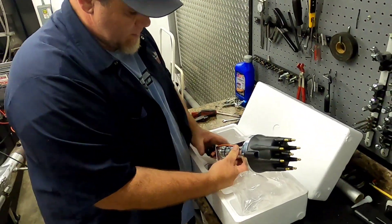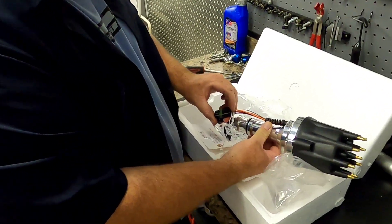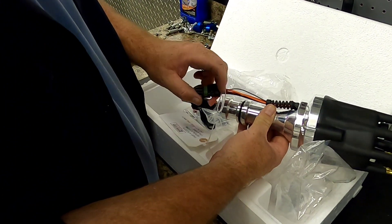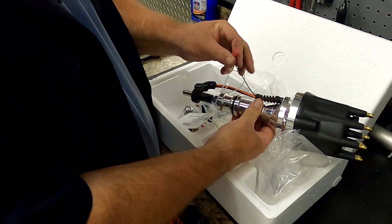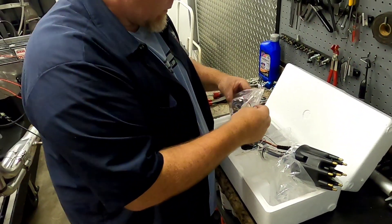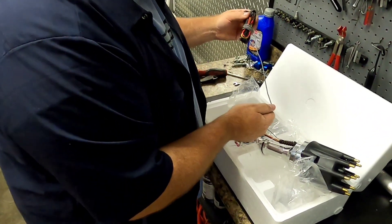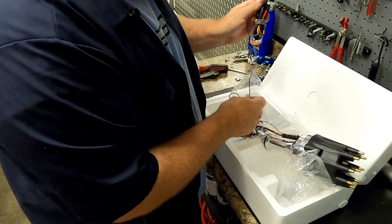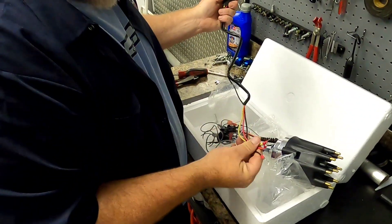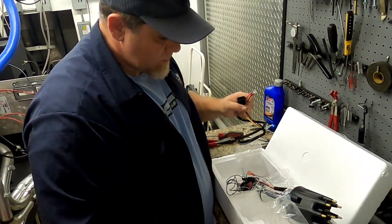One of the unique features about this is it's pretty much a four-wire hookup. You've got your 12-volt power source, your orange goes to the negative side of the coil, ground, and this is for tach signal. It actually comes with a little connector harness — it's an all-weather-tight 3-pin connector harness where you can just make your connections to the coil and ignition.